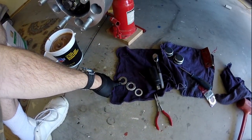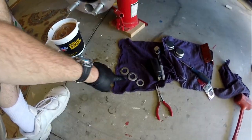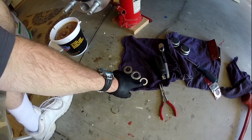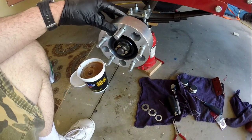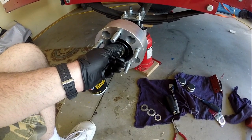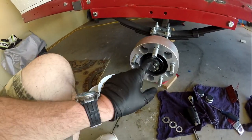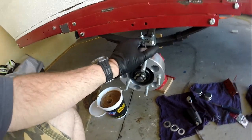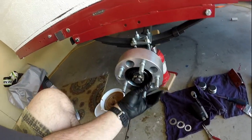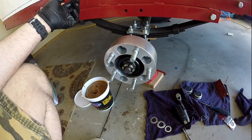I think I got it figured out. That was the washer that came with the hub — goes on the outside of the bearing between the castle nut and the bearing. I bought this extra one — this is thicker than that one, and this one's thinner. The first thing I tried was the stocker backed up with the thinner one — it was better, but the nut was still really loose. So I took off the stocker, took off the thick one, and put just the thin one. I got an extra turn out of it, and the nut ends up getting snug, and then it lines up perfectly — absolutely zero play in there at all, and it spins really free. Now I'm going to pack it full of grease, throw her back together, and tackle side two.